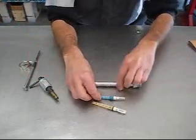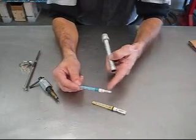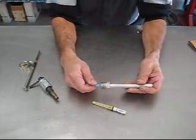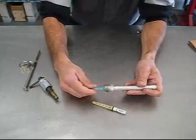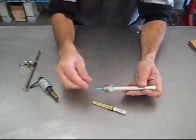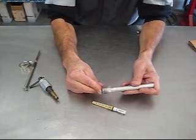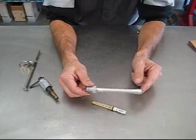When these orifice tubes fit into a pipe, they do need to fit in tightly. You'll see there are two o-rings — some orifice tubes only have one o-ring. Put a little oil on them, and when you put them in, be very careful to make sure you're not pinching one of those o-rings. They can be kind of hard to start, but they do need to go down smoothly, and you'll feel the o-rings actually stop at where the dimple in the tube is.